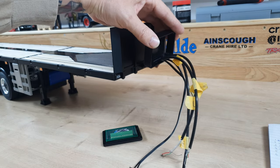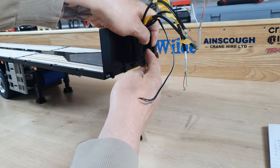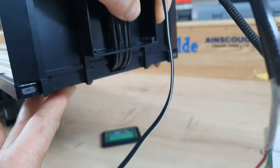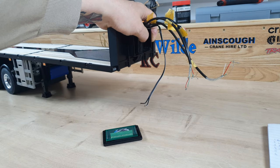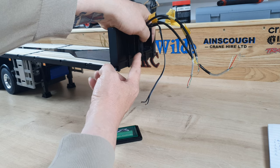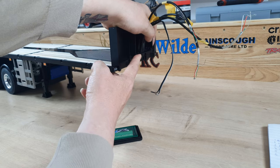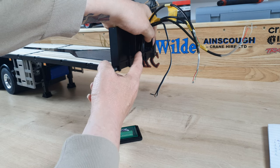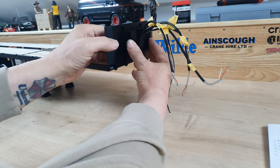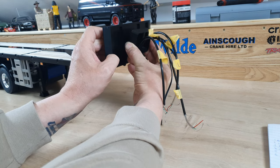So what I'm going to do is bond this box to the front of the trailer so I can trim off all these wires, and then underneath you're not going to get a mess of wiring — it's just going to be quite neat. There is a cover to go over underneath here like a Susie rail. I've had a look at the different adhesive pads I've got and they're too thick, and the thin ones aren't strong enough, so I'm going to use something I really don't like using — hot glue — but I can easily remove it by dribbling some isopropyl alcohol down the top, which will just dissolve it and it'll come off.